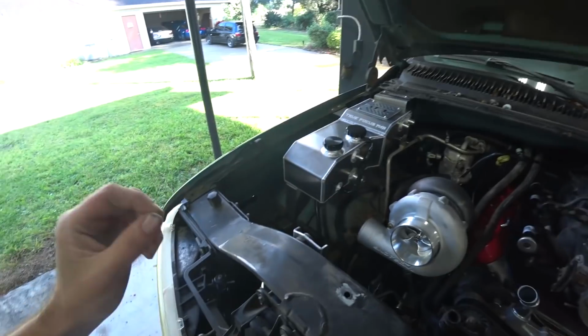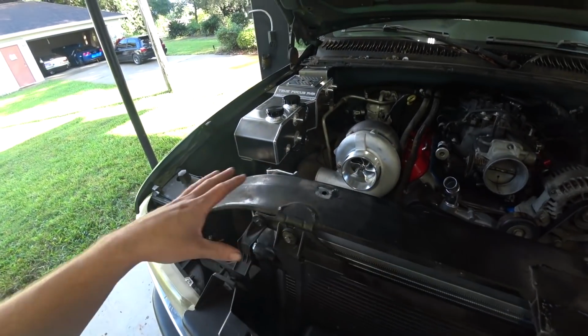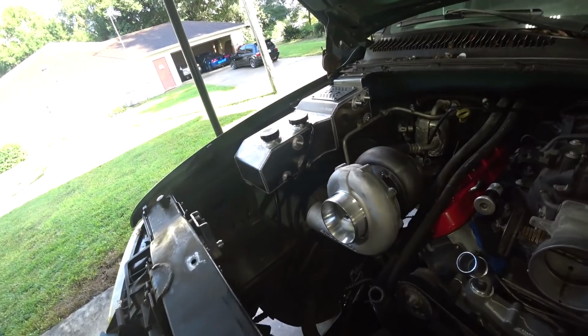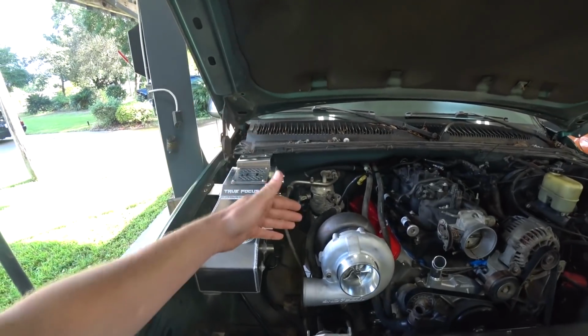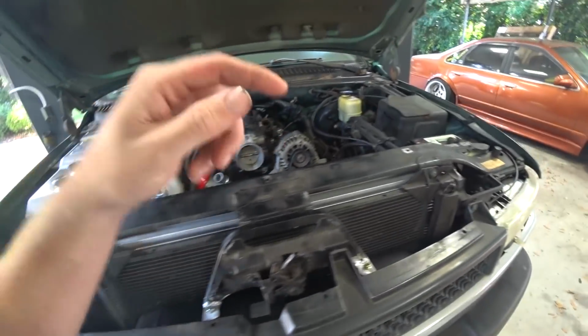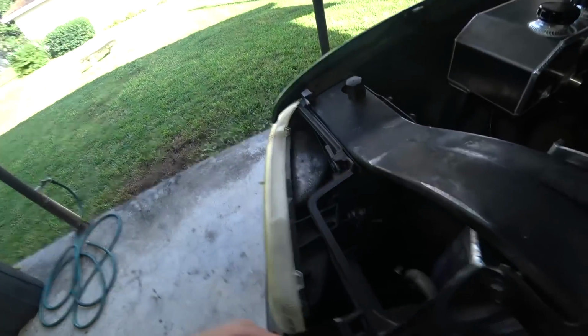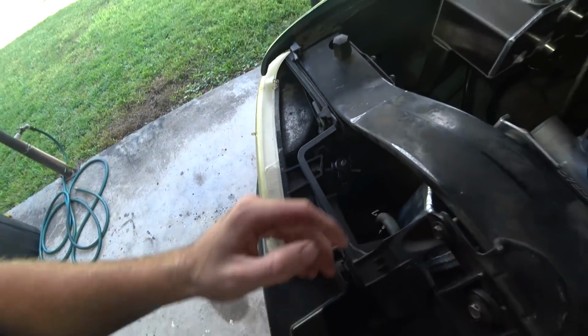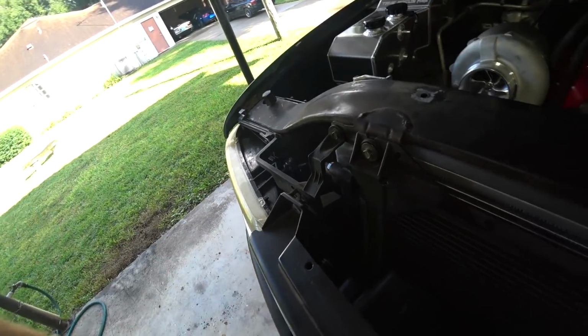What we're gonna start with, intercooler piping. So last episode, we got the intercooler mounted, we got the radiator and the core support all in, we got that all figured out, we got our tank mounted, our turbos on. Now we just need to go from A to B, turbo to intercooler to throttle body. We've got a pretty tight gap to snake the piping through, but we did some massaging and some moving, and I think with some more cutting, we're gonna be able to make this work.